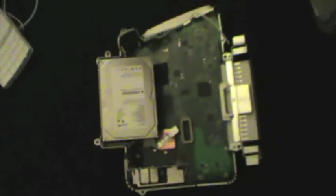Now, I've already pretty much mounted everything. I'm a little concerned, however, the connector that connects the logic board to the analog board, I don't think it worked. What that connection actually does is it sends power from the analog board basically to the secondary. It's this connector here. And I couldn't get a good firm seat on it, so it probably isn't going to light up, but we're going to try it anyway. See what happens. Yeah, I don't think it's going to work.